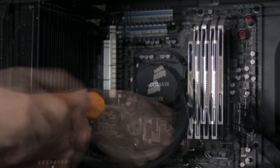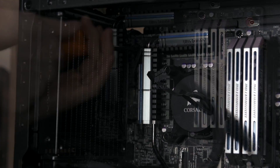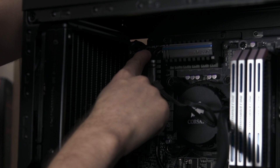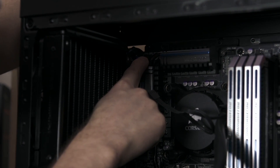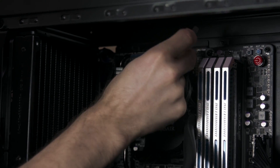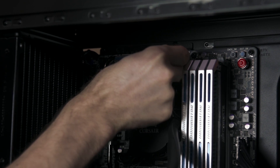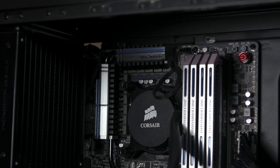With the screwdriver, tighten in a cross pattern so that you don't over-tighten one side first. All that's left to do is plug the fan cable into an available connector on the motherboard — in our case we used Sysfan3. It's important to note which one you used so you can monitor it in the BIOS later. Plug the CPU pump unit into the CPU fan header so the system will know if anything goes wrong and automatically compensate and shut down before any damage is caused.